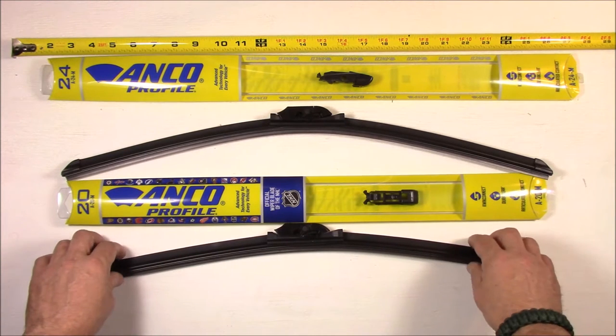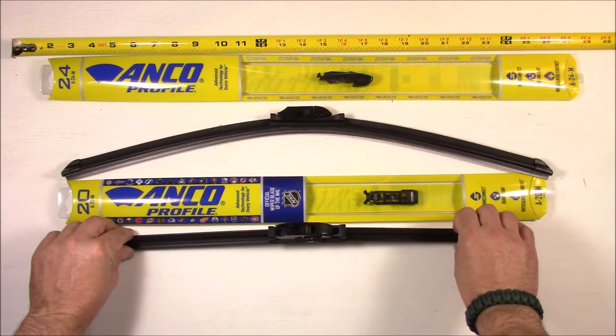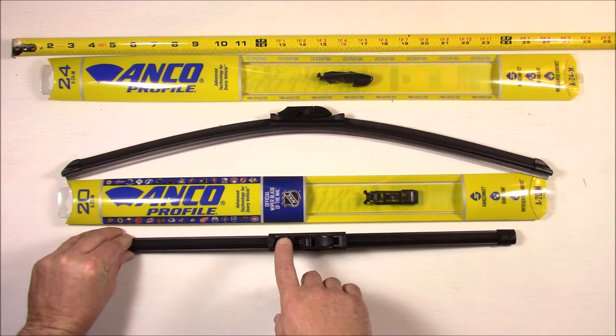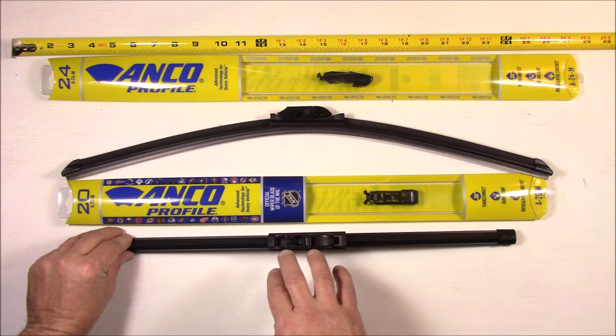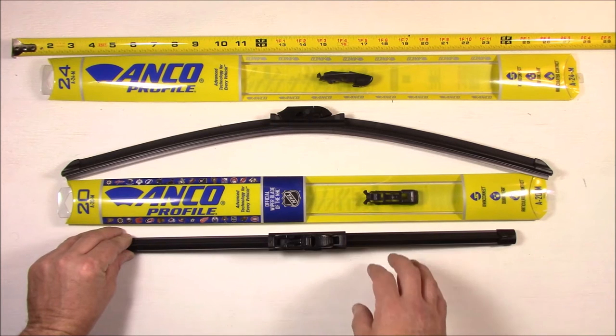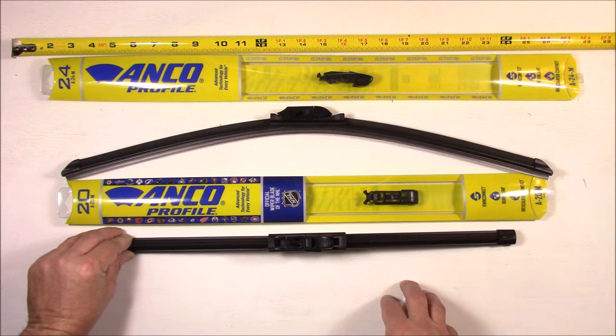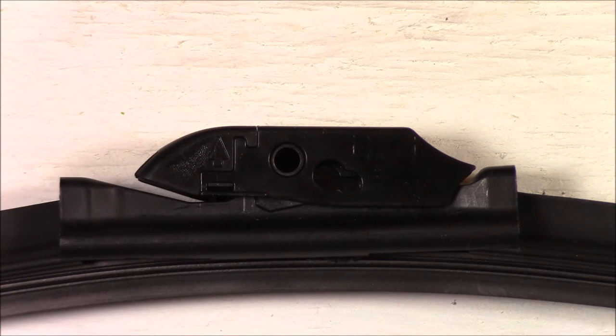The locking mechanism that comes with the wiper for the Kia Sorento is kind of unique — it has a double lock on it. I'm going to zoom into this clip and show you how it works, here on the table prior to putting it on the vehicle, as it makes it easier to show you how it actually operates. Here's a close-up of the mounting hardware or mounting clip. It's a two-step operation to get it mounted on the wiper arm.